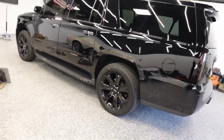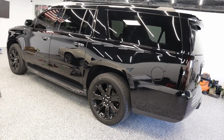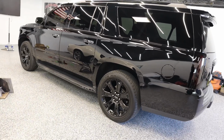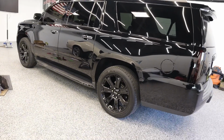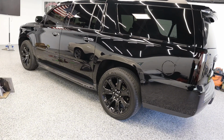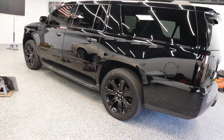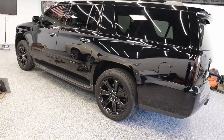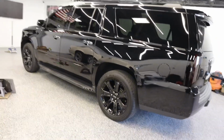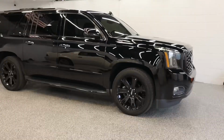A little bit raked, about 3/4 of an inch higher in the back than the front, which I'm happy about, because I'm also going to get the 2 front struts replaced next week. So I don't know if that's going to change what the front height is going to be. I mean, it shouldn't, but I don't know. So I'm going to leave it as is, finish up this back one, and that'll be it. Until I do another adjustment once the new struts are in.